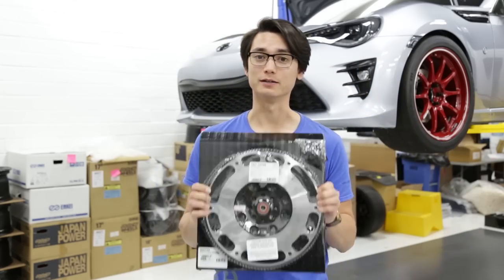The last component of the clutch system is the flywheel, and some kits do come with these. They're available in two versions: a normal version which is stock weight, and a lightweight version. That lightweight version is going to free up some rotational mass, which can free up some horsepower, but the big thing is how much faster the revs fall when you're changing gear. That's great when you're racing, but it's not so great if you have to drive through traffic on the street, so it's one thing you want to consider.